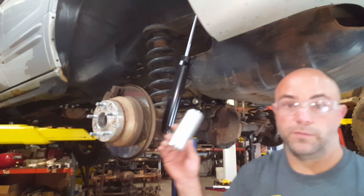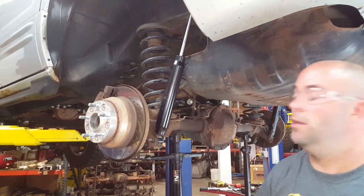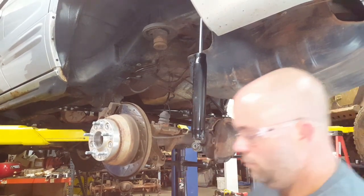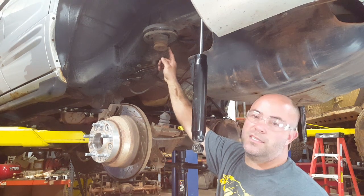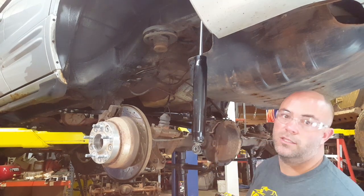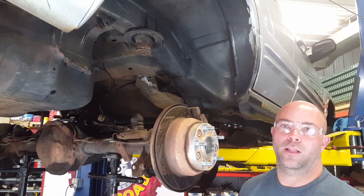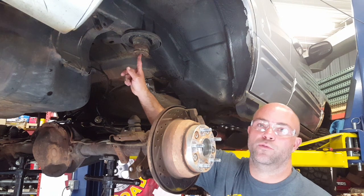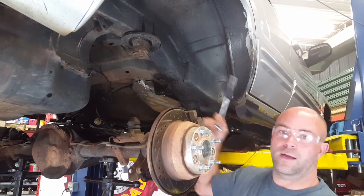Next, we're going to install our coil spring retainers. To do that, we need to take out the coil springs, and I'm going to remove the shock to let the axle droop a little more, with jack stands under the axle for support. Normally we drill and tap this hole, but since this is an Overland it has factory bump stop spacers — we just take that bolt out and bolt the new retainer in its place. Lift heights above four and a half inches or so will need these; below that, the coil spring won't unload so you won't need them. We've drilled these out with a 23/64ths drill bit and tapped with a 7/16ths-14 hand tap.